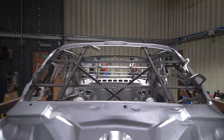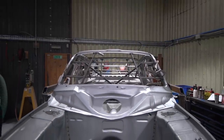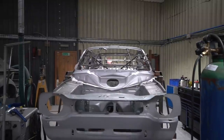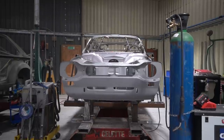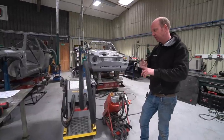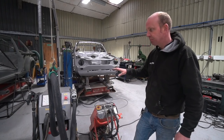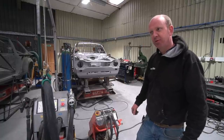Hopefully that's summarized a reasonable amount about panel replacement. Even though we've used an extreme example — replacing most of the body sides — you can condense the process down to a single small patch panel. The removal, cleanup, prep, alignment, and welding process is largely the same for any spot-welded steel construction vehicle.